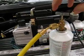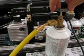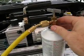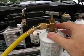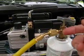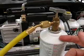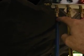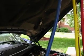It's a fairly simple procedure. You need to know how to use this pop-on fitting to open up these cans. You'll turn this screw and it'll puncture a hole in there, then you'll loosen it, which will allow the pressurized Freon to flow — up the middle, yellow — and it's going to flow to the left and down.